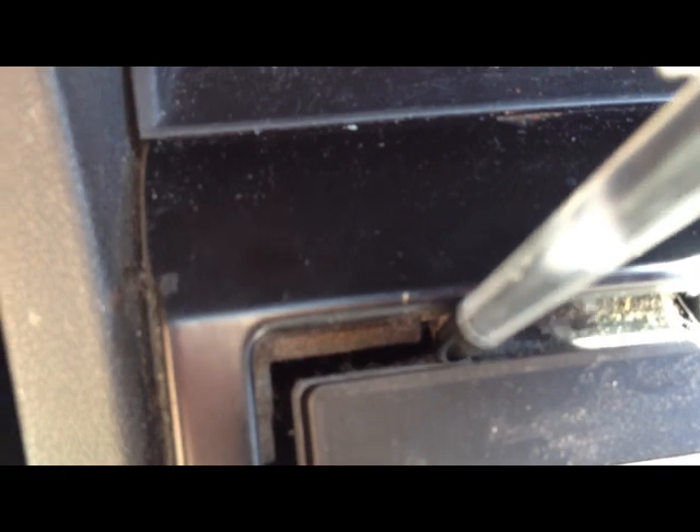So now, to give you a little better view here, this is where the pencil went — right up against that plastic clip. And then I just push that cable out of the way, just give it some pressure this way. That'll release the cable and allow you to take the car out of park.